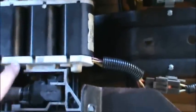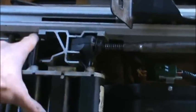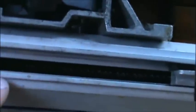And how the seat works is, okay, it's got these 3 electric motors, okay? This motor right here, the first one that you can see, runs all the way to these tracks in the center. You can kind of see in there, there's a screw. There's a screw on both sides, okay? So what happens is this specific electric motor will spin and it'll move the seat forwards or backwards on these 2 tracks. The 2 tracks that are right there. 1 and 2. So it just moves forward, moves back, okay?